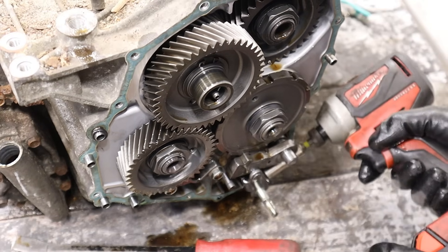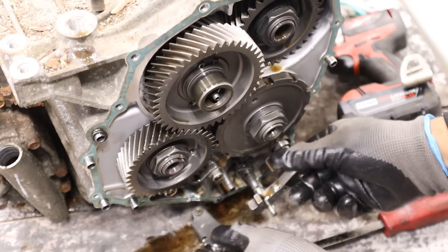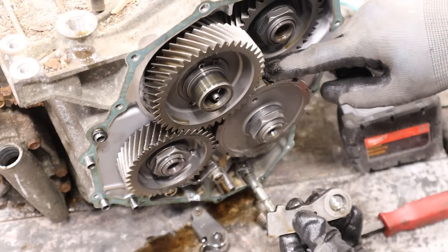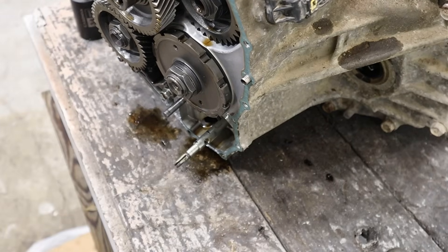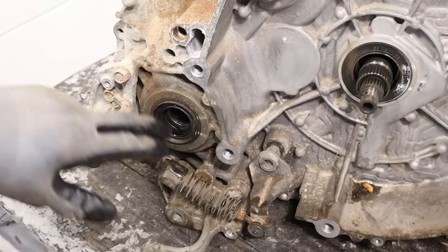Let's see if I can remove this bolt. I can use them with the parking pawl lever — and that's the tooth that's going to lock in here. The parking pawl shaft goes over to the other side where the shifter hooks up. Over on the front here, this is where the shift cable would attach.